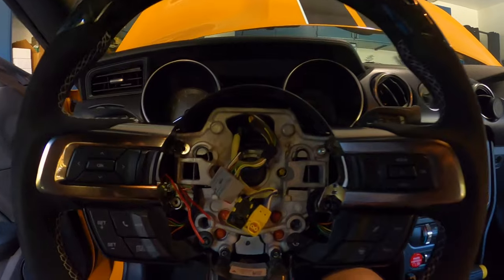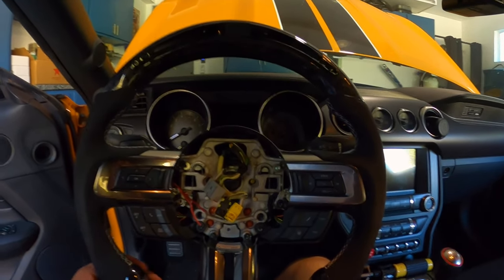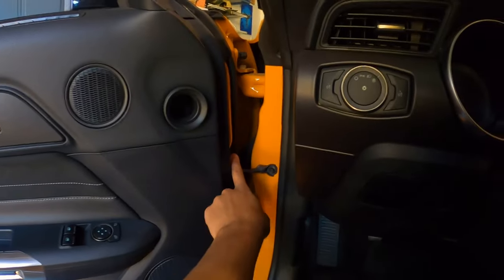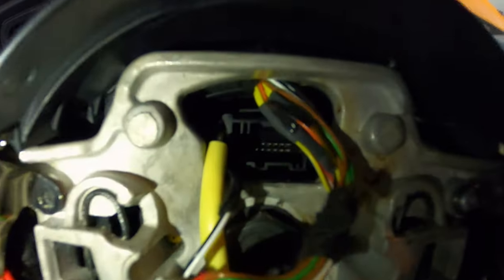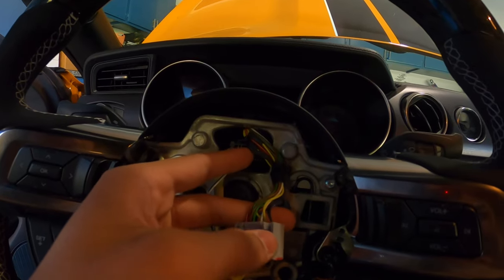About an hour later I finally found 12 volt. When measuring with a multimeter or voltmeter in your S550 Mustang, make sure your ground - don't use one of the points on the wheel as a ground with the voltmeter. I used a screw on the door and then I was finally able to measure 12 volts on the wheel. It's the prong on the bottom row, second one to the right side. That looks like it's a yellow wire - it's going to vary from car to car.